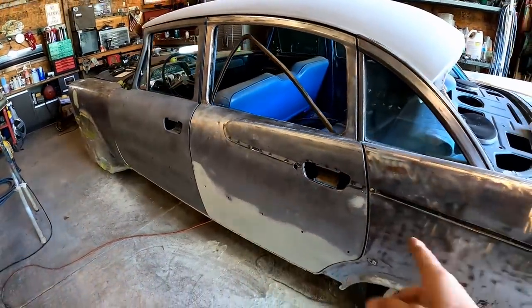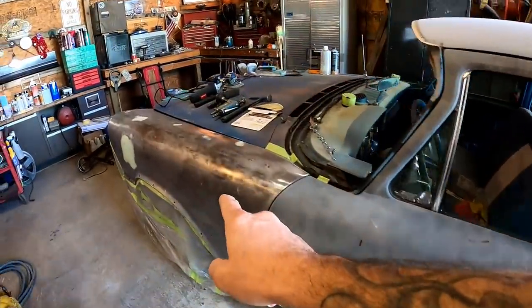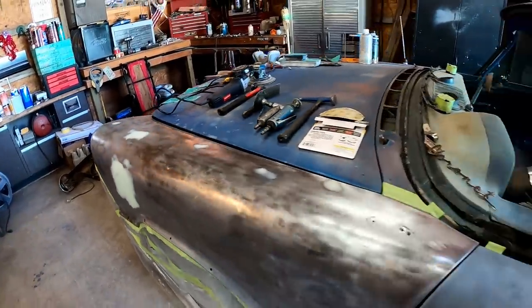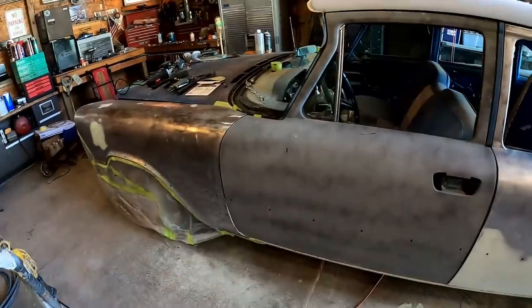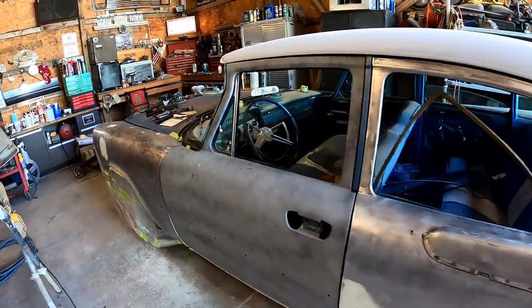What I want to do is prime all three of these panels. This one's already prepped and ready and even mostly masked off. So we'll come in, work this panel down, get it ready for primer, and then we're gonna nail it. We're just gonna hose it down with about three good coats of high build 2K primer.